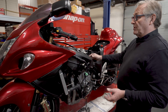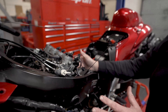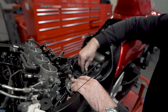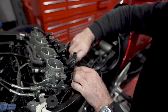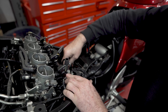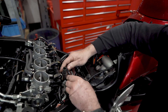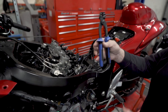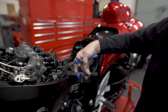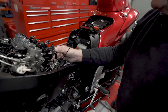This Gen 2 unfortunately has anti-lock brakes, so we've got this unit in the way of what would be an even simpler job. We lift this up a little bit and manipulate all the oil lines to clear the air filter — it's really only the air filter that's in the way, because it sits back down here. These pipes bend with your fingers, but there's a nice US Pro tool you can utilize to bend the pipes if needed. This one's going to have to come down because it will be in the way of the fuel tank.